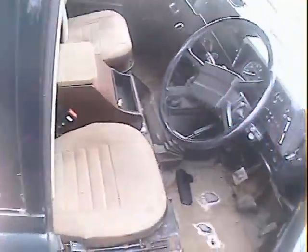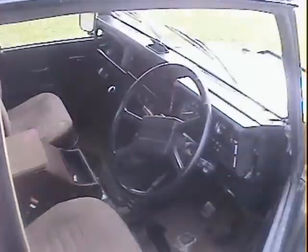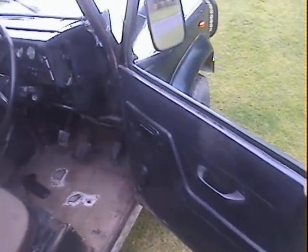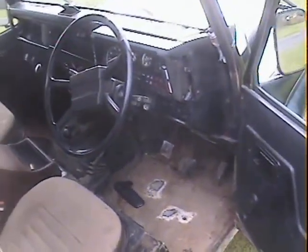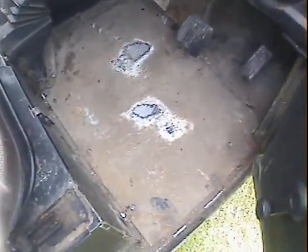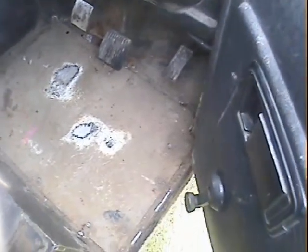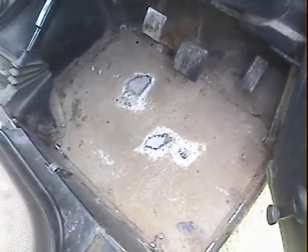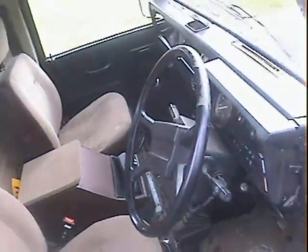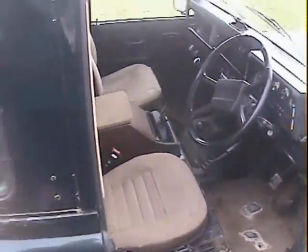The off side front wing again all looks pretty good. The driver's door really needs replacing — it's going quite badly around the front hinge. It still closes, which is fine, but it's getting very weak around the bottom hinge in terms of the door frame, so that needs to be done. That mirror's falling off again. The driver's footwell looks like it's been repaired — there's a section put in the corner, not too bad. The driver's seat is good — all nice in there. Just really the driver's door frame is poor with a lot of movement in the hinges where the skin is flexing.